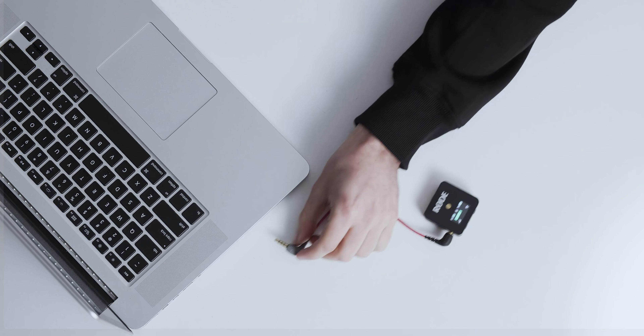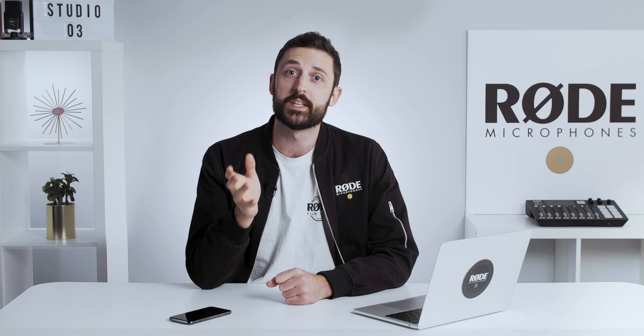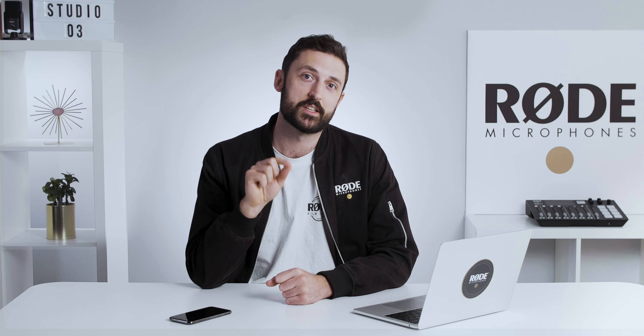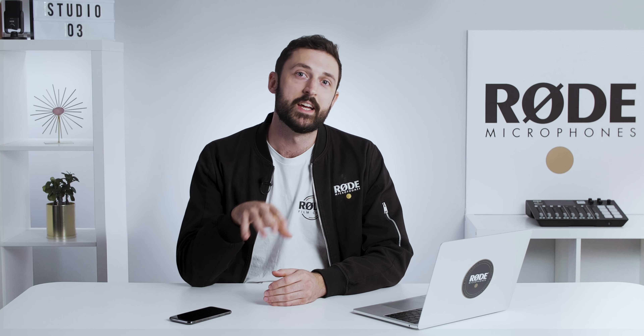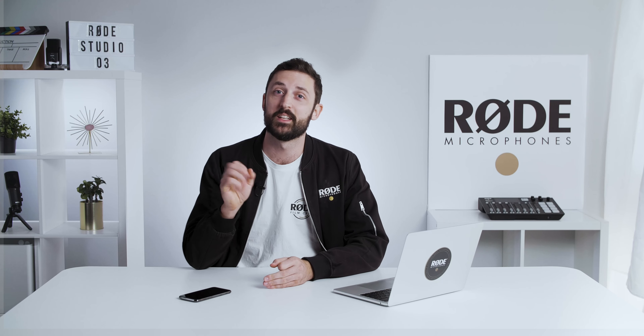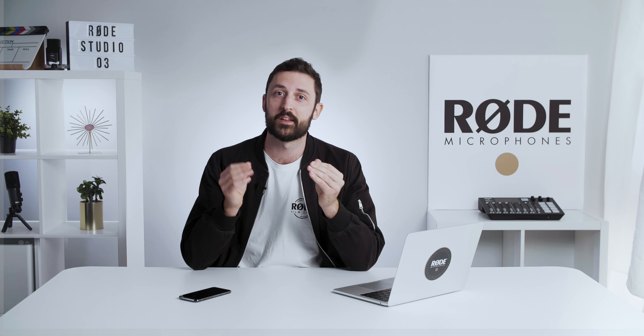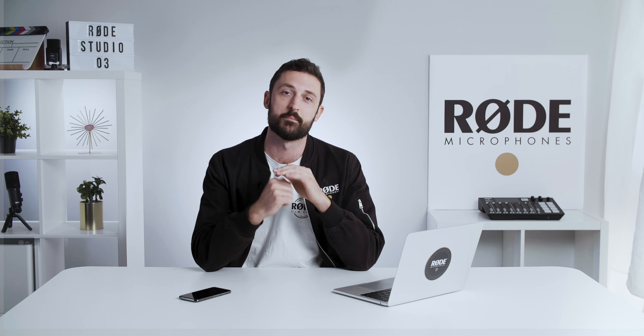Simply plug the black end onto the microphone cable and put the gray end into your laptop. For the SC7, plug the black end into the microphone and the gray end into your phone or laptop. Once connected, you may need to select the external mic in your device's audio settings or your recording or streaming software. In most cases this will give you a great result, but unfortunately some phones and laptops will have issues recognizing that an external microphone has been connected, even if you are using the correct gray TRRS connector. This is actually a limitation of some device hardware, as phones and laptops are not really set up for use with external microphones in this way.